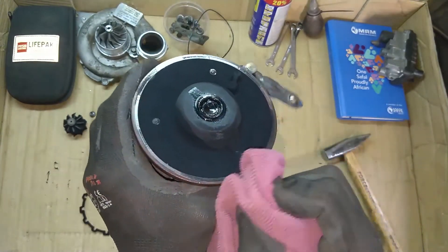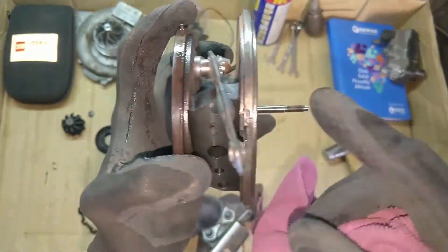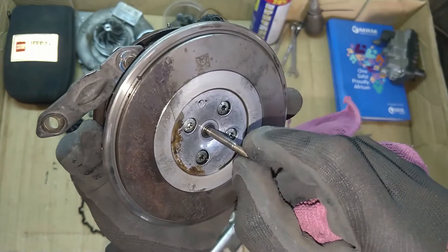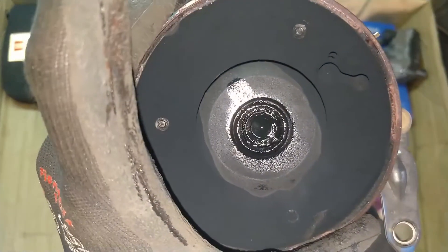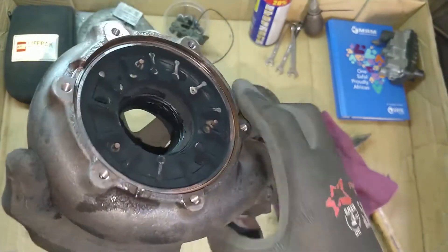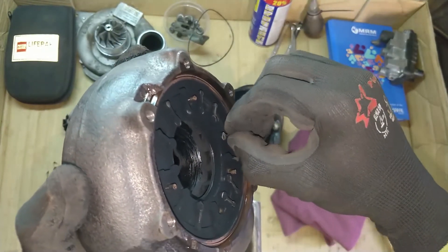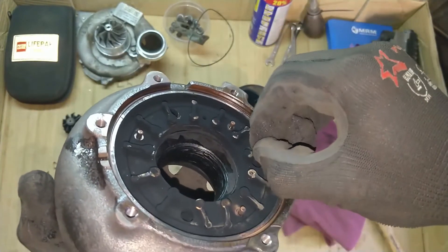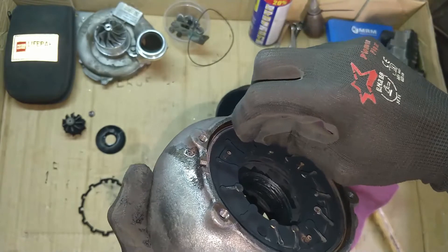So I think we have our answer — this was catastrophic failure. Extreme catastrophic failure. The shaft just seems to have sheared right off and has a fair amount of play. So this unit seems to have died. The vanes feel right but they're pretty sticky. Going through them: sticky, not so bad, sticky, sticky, not so bad, not so bad, sticky, sticky. So most of them seem to have also had a better day.